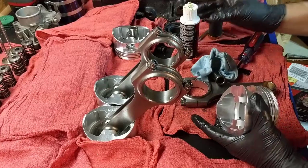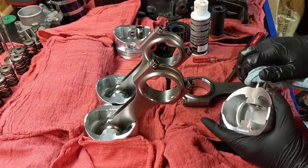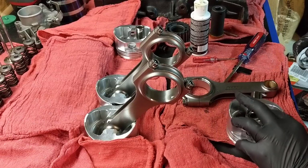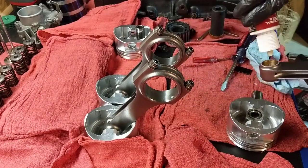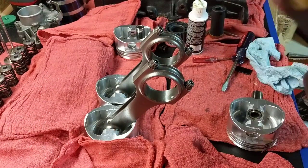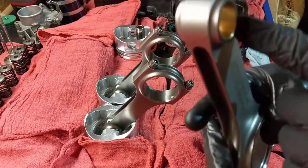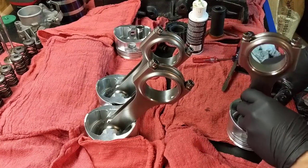More. So, it went. So you need to work it out sideways and twisting a little bit, some of them. I don't know, mine was used, that might be the issue, but let me see if there's nothing in there. There you go. By the way, I'm just blowing the oil grooves, which are those holes in here and in here, and they have connection inside. So you see inside there, just to be sure there's nothing there. I've done the two before, so that's why I didn't do it.